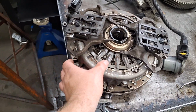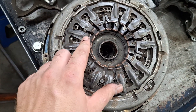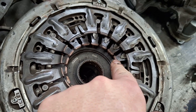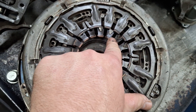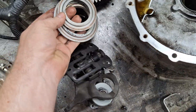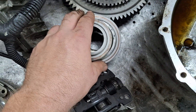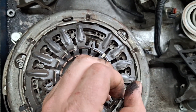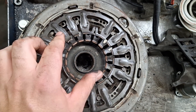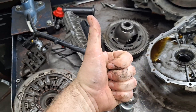In case I wasn't clear on the clutch assembly — this assembly houses two different clutches and pressure plates. Here's one pressure plate and here's another. Each of these pressure plates is where the Z washers push. Here are the Z washers; they sit on the slave cylinder. Those Z washers take the impact when the clutch applies — when the fork moves up, it pushes against the Z washer, which pushes the pressure plate and applies each clutch.